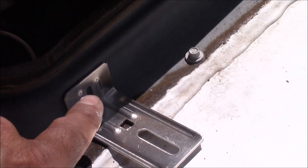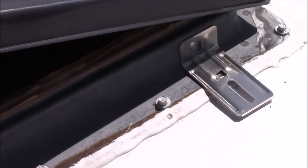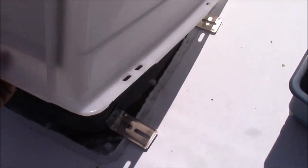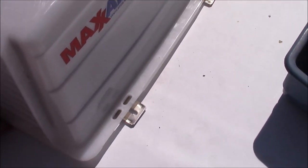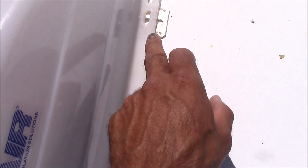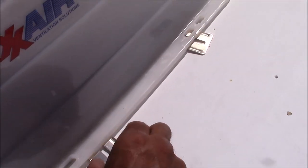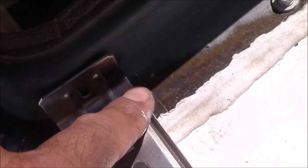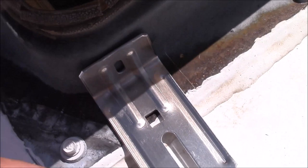I'm going to start by placing these against the side of my roof vent — one towards the front and one at the back, spaced about 10 inches apart. Now I'm going to drop my vent cover down in place and line it up with my brackets. More than likely you're going to have to adjust where the brackets are so they line up with the holes on your vent cover, so just slide those brackets to where they line up with your holes. Once your brackets are in position, remove the vent cover and mark where your brackets are with a pencil. Your brackets should be in the same position on the opposite side; if not, you'll need to adjust and realign.